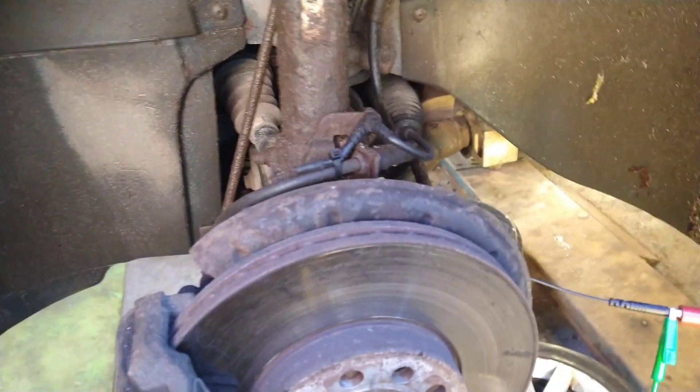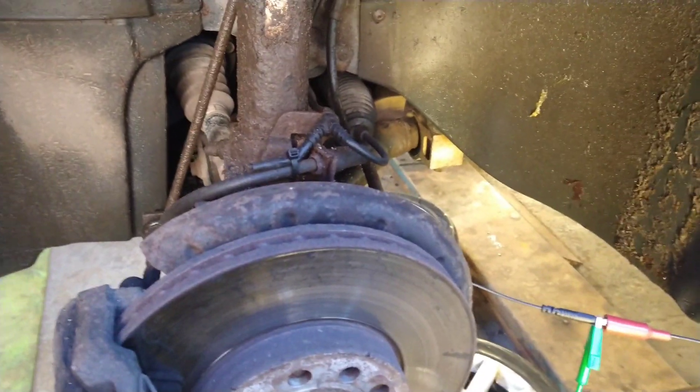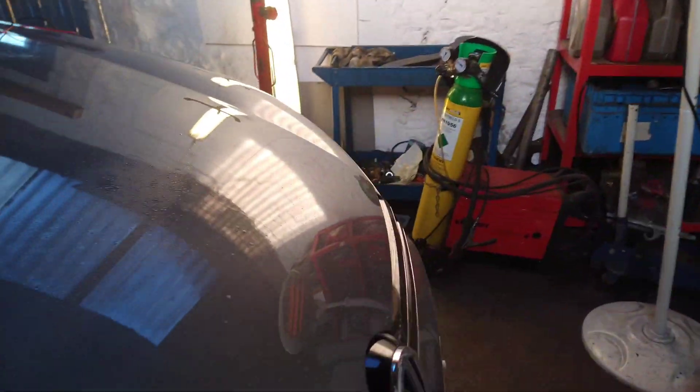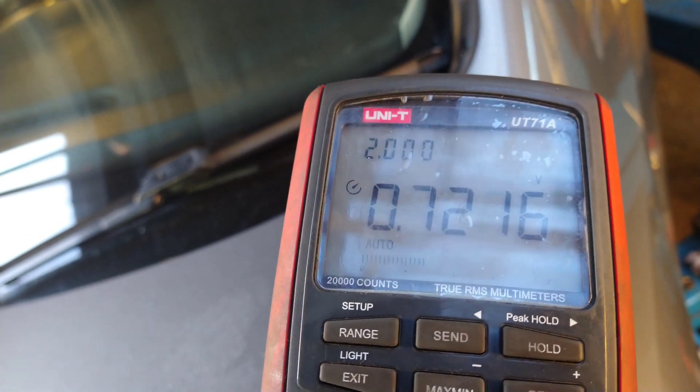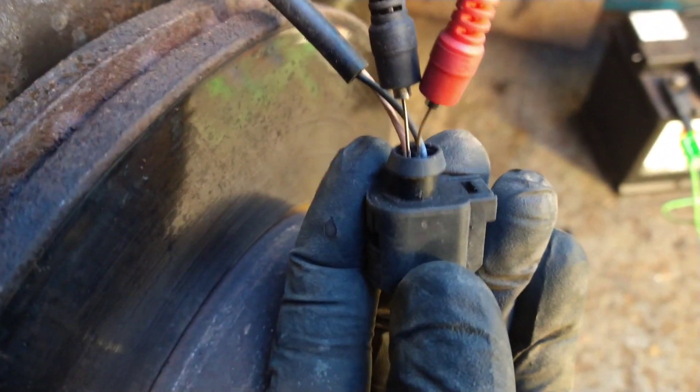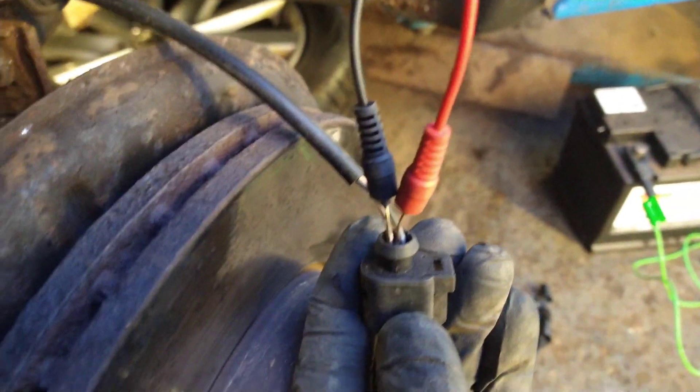I found it very useful in this case, so I know the problem — I've got to look at the wires. Now I'm going to check the wires here, using different wires, checking the car's wiring. Going into a voltmeter with the ignition on, I've only got 0.7, 0.9 — not much of a volt there. There wasn't enough voltage when I was at the front of the connector. So I'm doing the same test again, this time I'm at the back of it, two back-probing pins.